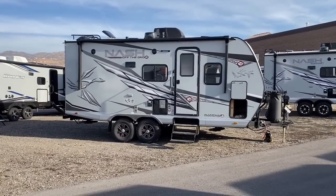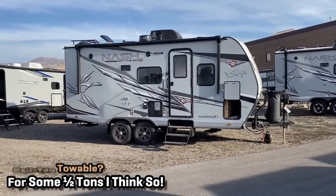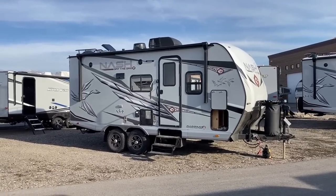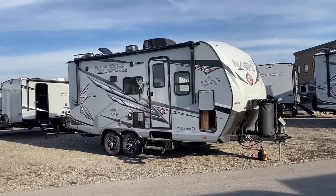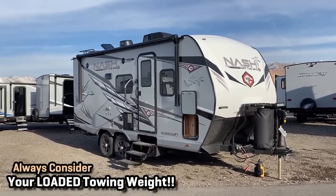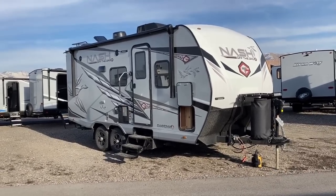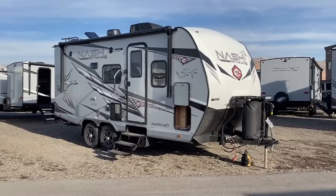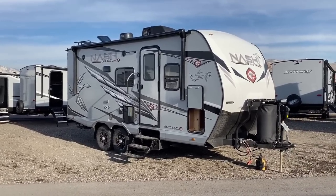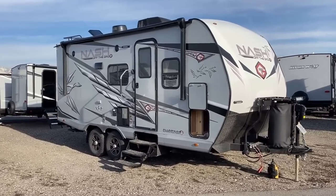This is one of the very few Northwoods I think is potentially legitimately half-ton towable — not just because of its smaller size and tandem axles, which will help the ride and handling, but because it's about 6,000 pounds dry weight. These have a pretty hefty cargo capacity, and once you add water and gear, she's going to weigh more than 6,000 pounds when towing. A lot of tow-package half tons will still handle this one safely and comfortably. That said, I don't think you'd regret having a three-quarter-ton gas truck — it would handle this very nicely.